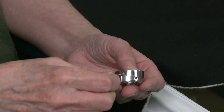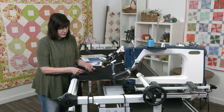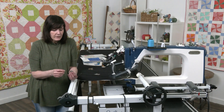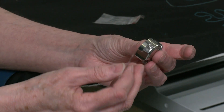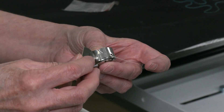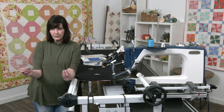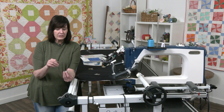Let's put it in the right way and then tighten up the tension screw. I like to use my foot height gauge to adjust rather than my fingernail - if you have your fingernails nicely done, you don't want to ruin them. The foot height gauge has four corners that work well as a little flathead screwdriver. Remember the rule of thumb: lefty loosey, righty tighty. So face it towards you - left hand, right hand - and you'll know which way to turn the screw.